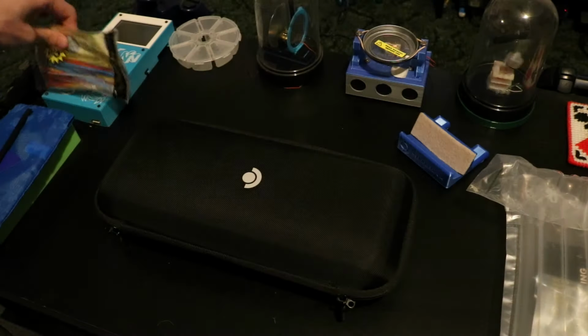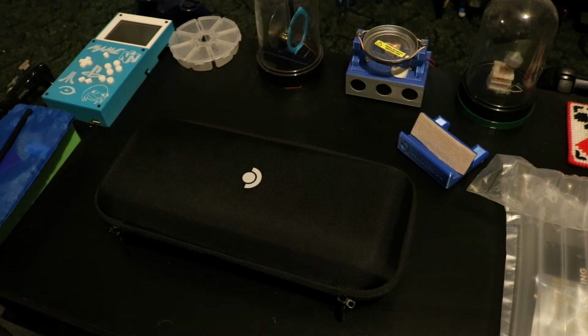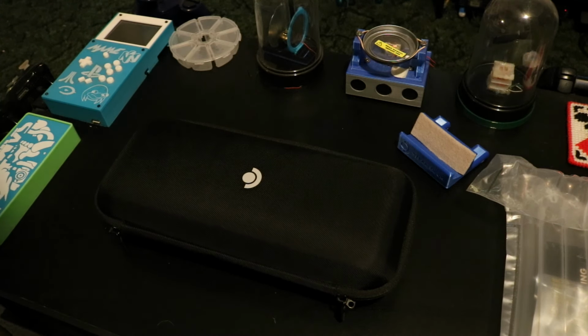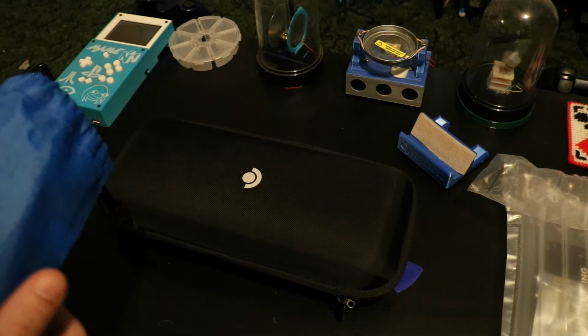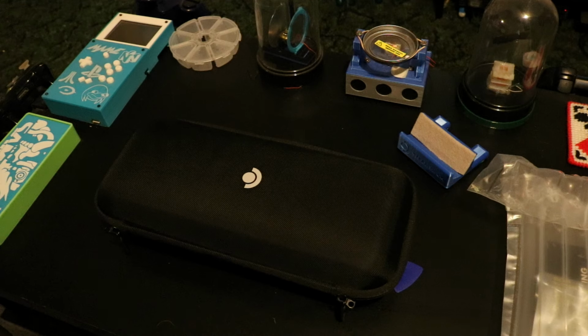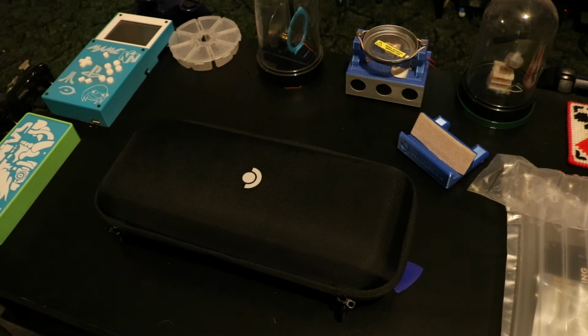So alright, to take the Steam Deck apart now, we're going to need some tools, and I recommend using some tweezers. Alright, jokes aside, if you got that reference, you're pretty cool. But seriously, tweezers will help. We also want some plastic spudgers. They can come from any kind of fix-it kit, or if you don't have one available, you can use a credit card or some other thin plasticky material. I sometimes use these plastic hanging hooks from old plastic boxes. They work pretty good in the long run. I didn't need to use them here, however, because I had a pick lying around.